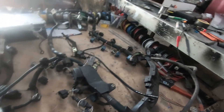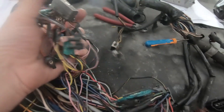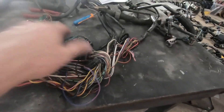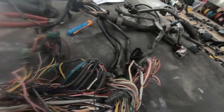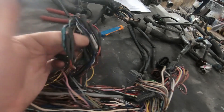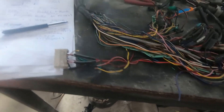Update on the Supra for another day - the engine loom for the UZ is sitting on my bench. I've deciphered this mess, got my own diagrams and a bit of a wiring plan happening. So that was the 1G-GTE - every single wire on the body plugs was cut. I've got a feeling that when it was converted from auto to manual, possibly the loom plugs were cut off and several of them just fell to pieces. I was having trouble tracing them and that's because there was no continuity in the joints.